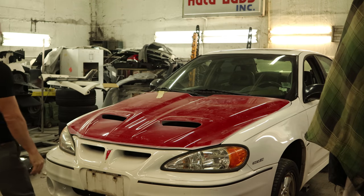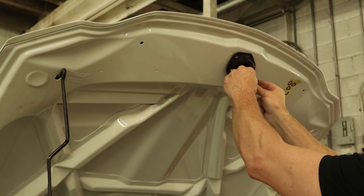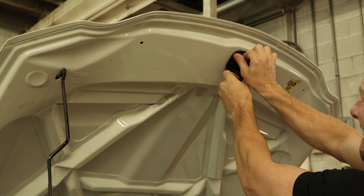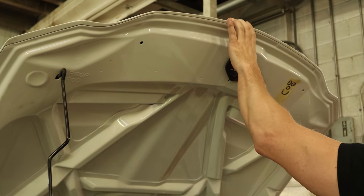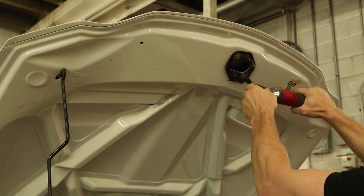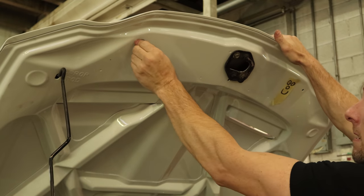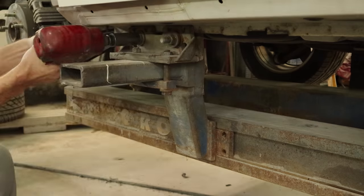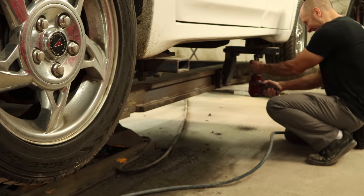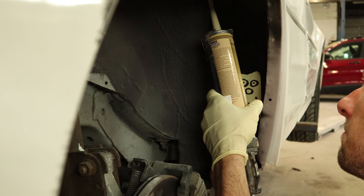Check our gaps — they look good. Now we can put our striker back in for our hood latch. There's no adjustment on this, so we can just bolt it in and it should latch. Put in our rubber baby buggy bumper — we're going to have to go find one for the other side. Now we'll unclamp it from the frame rack. We'd use an extension to get to these bolts because we didn't take the rocker molding off, because we're lazy.